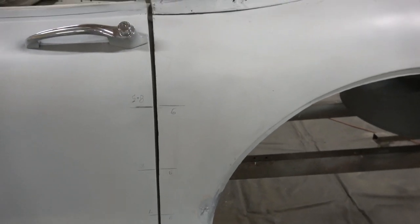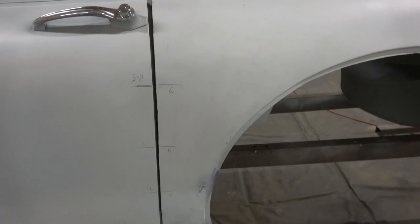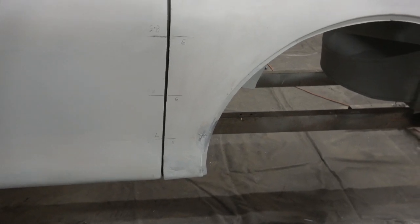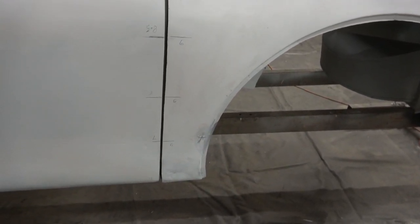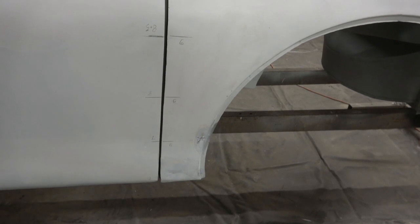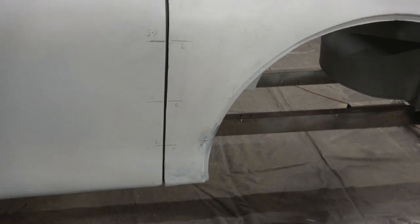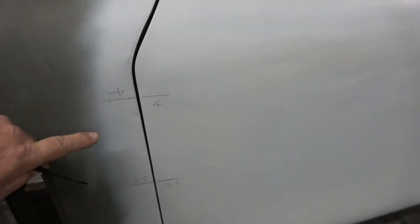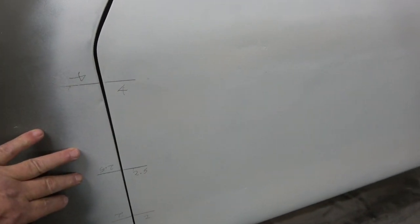It's critical that we put it onto the chassis to make sure these door gaps are correct the right way up. It seems like it's out of stress now, but it's under compression or tension when it's inverted. On the front, conversely, this is different because you've got two huge bonnet hinges — and you can see whether it's inverted or not, it's 4, 2.5, 2. That's because the A pillar is massive and it's got massive hinges on, so there's no movement there whatsoever, even though all these gaps have got to be redone.